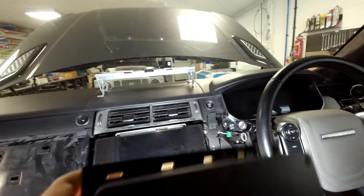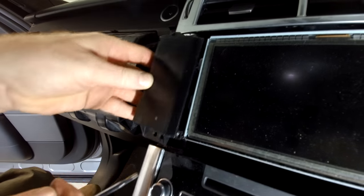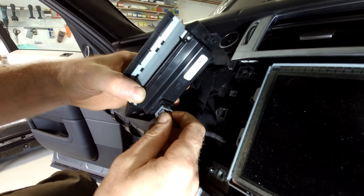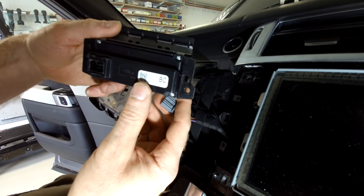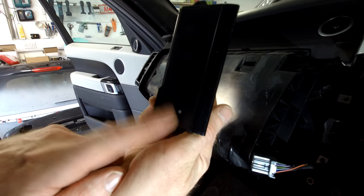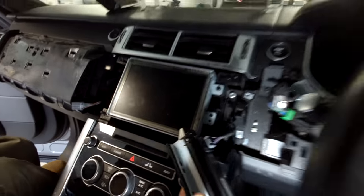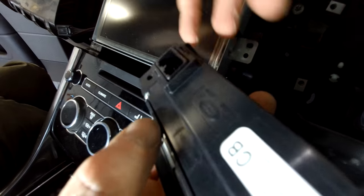These locate on the little pins down here, so we should be able to remove now. There we go — there's a little connector on the back. To unplug it you push that little tab in and give it a pull. I don't know if it says left or right on there, but that's the left-hand one. This little dot is at the bottom and the slope goes towards the screen — remember that.